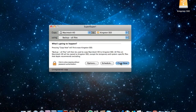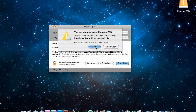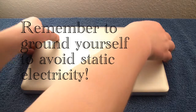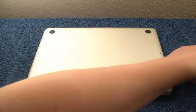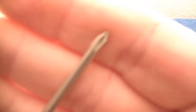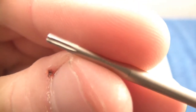The cloning process will take up to a few hours. When it's done click OK and you have an exact copy of your hard drive. Then turn off your computer, disconnect all cables, and begin opening the computer. You'll need a small Phillips head screwdriver to remove the case and the hard drive bracket, and a T6 Torx screwdriver to remove the screws attached to the drive inside the computer.